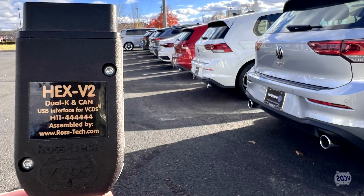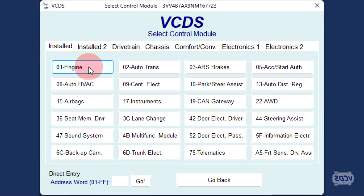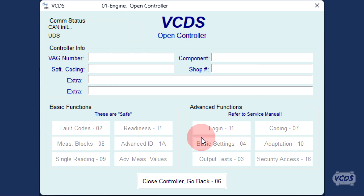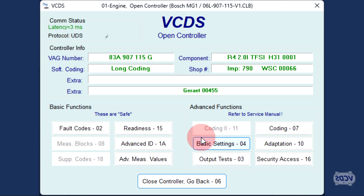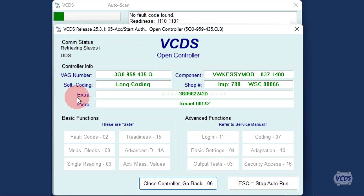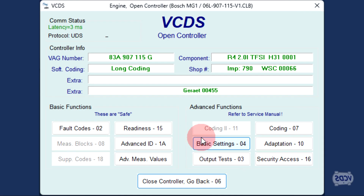Just plugging an enthusiast kit up to a car does not register or store a VIN. If you get a pop-up message about saving a VIN that you are not committed to, just click cancel and you can continue with the entry-level functions. By design, the entry-level functions of VCDS are available so you can do auto scans on as many vehicles you have access to.